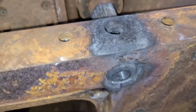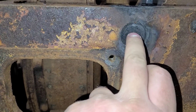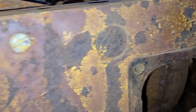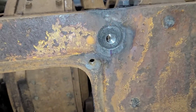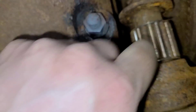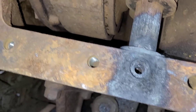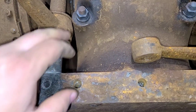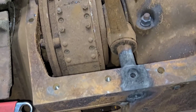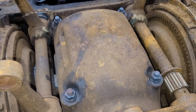I got it to move about that far. I think I'm going to end up making a puller that spreads the load over this casting with a threaded rod I can thread in there, and actually pull it out while putting a little heat on it. I almost guarantee we'll have to do the same thing to the other side. More than likely I'll end up making new pins for these anyway, being that they are a bearing surface — there are needle bearings in here. That's really not that hard to get a hold of a new shaft and drill a couple holes in it. So I think we're going to pull this cover off and have a look inside, and we'll have to revisit pulling these steering clutch shafts out. Let's go at these bolts and see what's underneath.